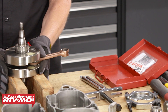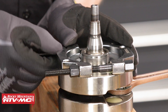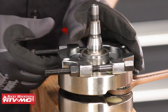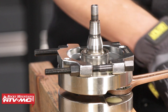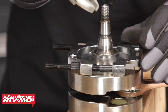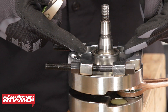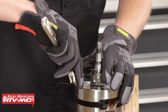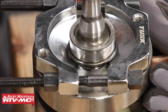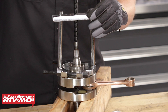This works really well if you grab a couple of blocks of wood to work on. If your bearing or race is still on your crankshaft, we'll use our Tusk crank bearing puller tool to remove it. If they're not and they're still in the cases, we can use our Tusk bearing remover tool or a socket and hammer. Tighten it up evenly from side to side — the idea is it will squeeze together underneath the race or bearing so that when you attach your puller to the top, you can just pull it right off.